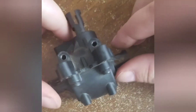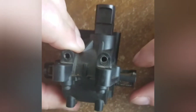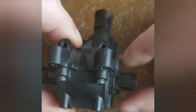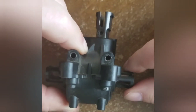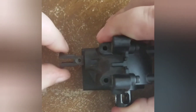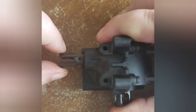The last thing you would check — now we've got the screws in, so this thing is together and shimmed — is you'll take the out drive and spin it. You can see that it's spinning freely; there's no hard grinding. You'll know if your mesh is too tight — if there's zero play when you grab it, there should be some play. If there is some play, you're good.